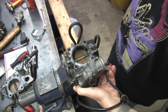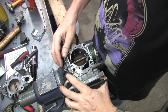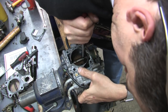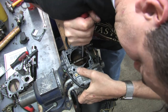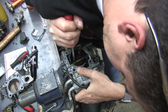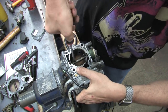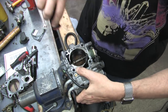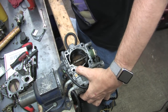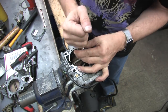But after I quench the parts, I heat them back up again, and let's give the plain old screwdriver a shot. Okay, well the first screw stripped pretty bad, so let's see if the other one bites. The screw broke loose with heat, penetrating oil, and a regular old screwdriver. That's a pretty sharp contrast to all those claims that this requires an impact driver. But the people who recommend it still aren't wrong. It's just the most destructive means of doing this.